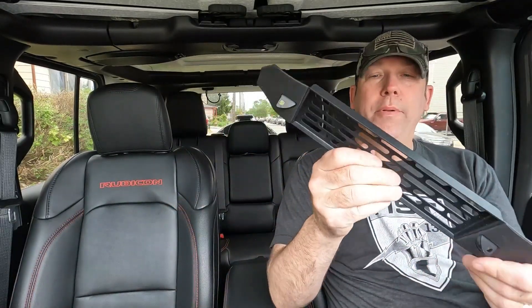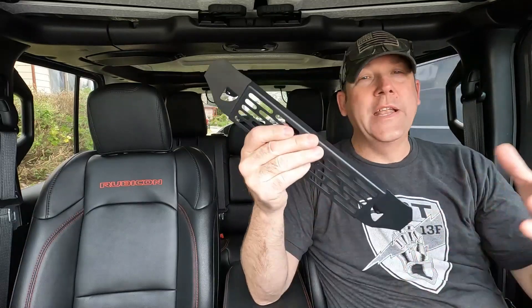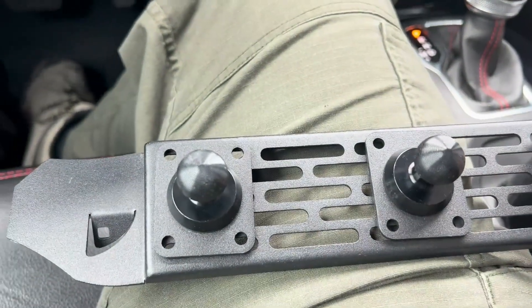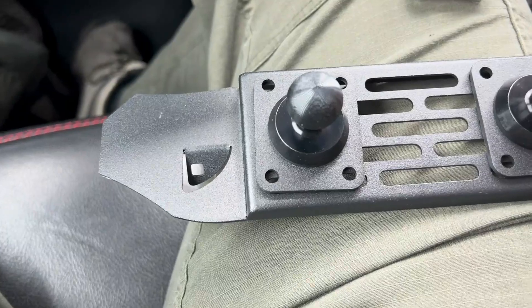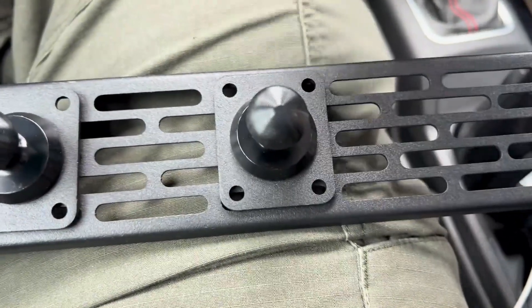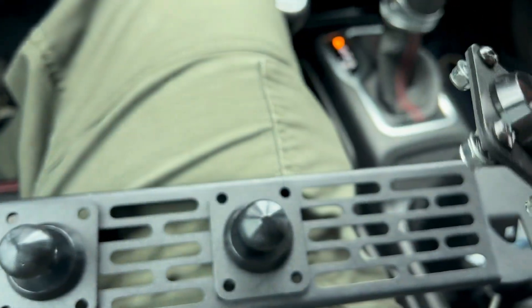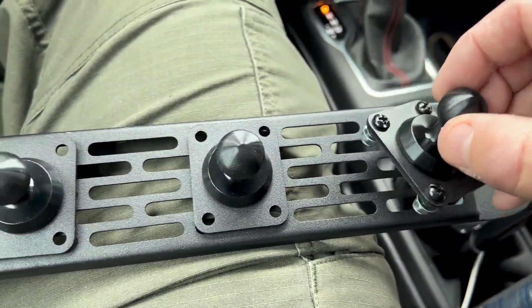This steel plate is going to go right here on top and mount like that. So let's get it in and show you what it looks like and change out this mount that we have. The first thing you want to do is secure these mounts to the plate, so you want to separate them where you want them. I'm going to spread mine out like so — I'm going to have a phone mount here, a GoPro mount, and then another phone mount. With the supplied nuts and washers, you're going to place them and screw them in exactly where you need them, before you go and mount your plate on the dash.